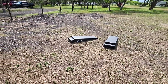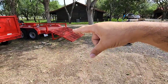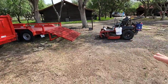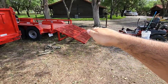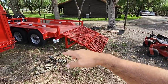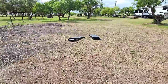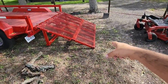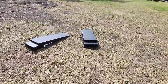There's no real difference in what these will accomplish for a car versus a zero turn mower with the same challenge. The difference is on a car you have two breakover problems: the first is your front overhang where you can scrape going up the ramps, and the second is that same breakover angle getting onto the trailer. So there are a lot of reasons to use Race Ramps to lift the back of your ramp slightly for a shallower loading and breakover height. We're going to use them in a bit of an unconventional way — putting them underneath the front of the ramps for a zero turn.